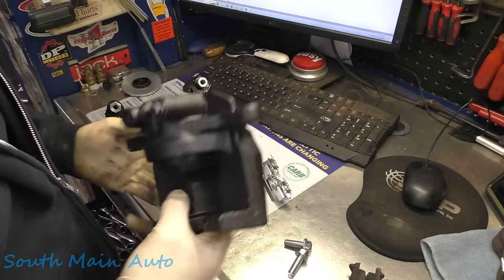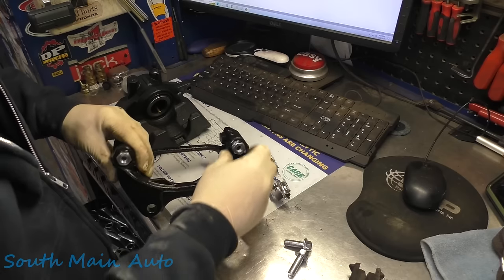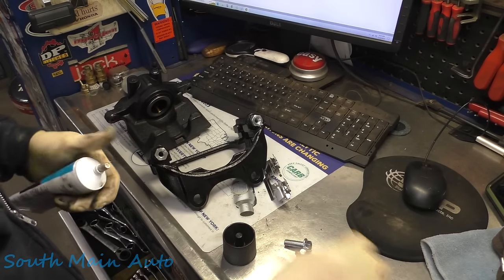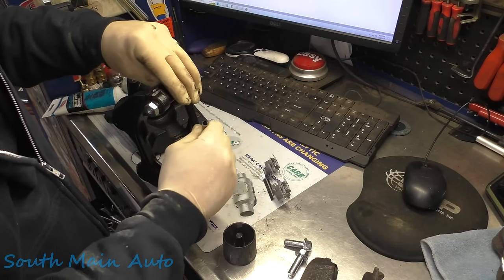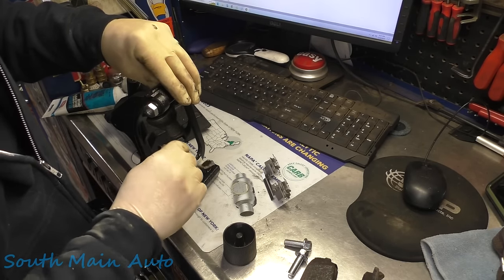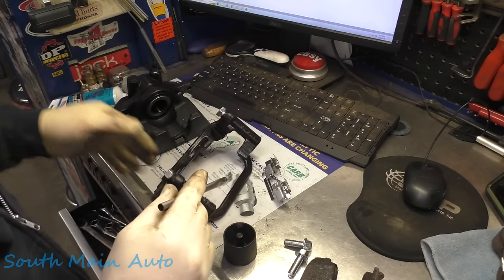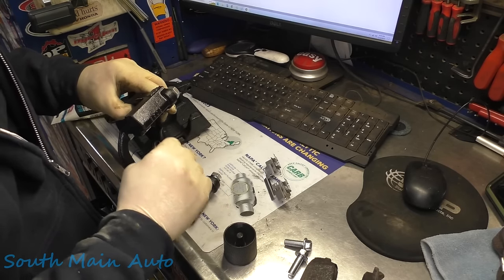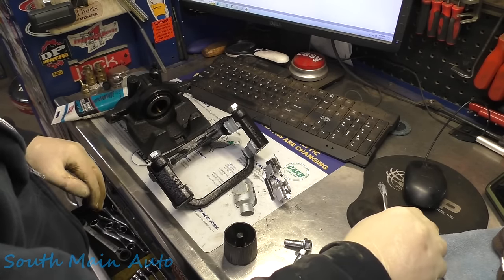We got us our reman caliper here from NAPA. Not a sponsor, of course. Make sure their pins are freed up here. Sometimes you get the reman stuff, you never know. We'll put a little grease on it to help our hardware from seizing up here in the future. These painted brackets usually last quite a while. By that I mean you get a couple years out of them, typically, before they start getting all crusty. I don't know who's remanning calipers for NAPA now. It switches back and forth. Sometimes it's Cardone, sometimes it's BBB Industries. I haven't looked lately to see where they're sourcing them from. Stick that there and we'll put our...